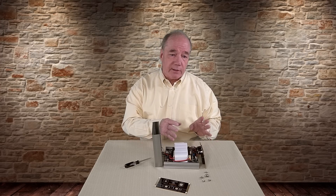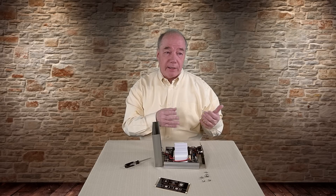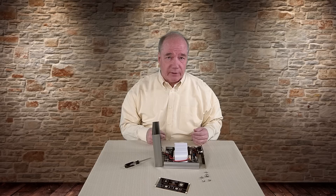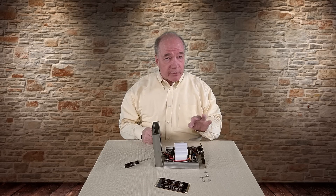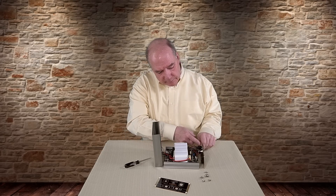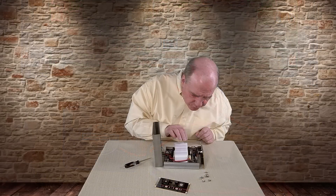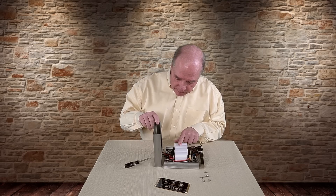I did check this — they claim it's a sinusoidal wave. A lot of AC inverters generate either a sawtooth wave or a modified square wave, which is not great for sensitive electronics. You want as smooth a sinusoidal wave as possible, and this generates almost a perfect sinusoidal wave. Very complicated circuitry back there. On the back portion, they've got glue holding in those sockets so they won't vibrate loose, and just tremendously good electronics inside. I'm going to try to get a look at the battery pack to see exactly what's inside there.